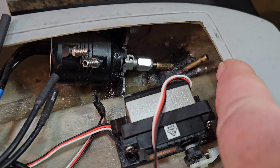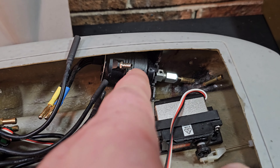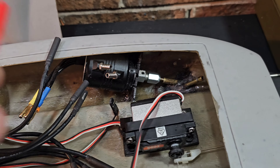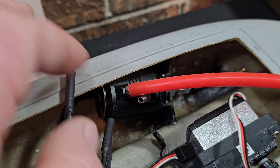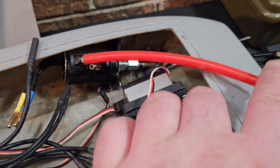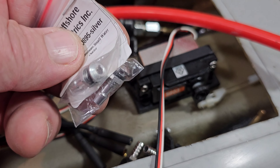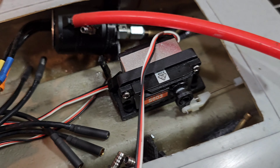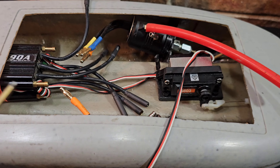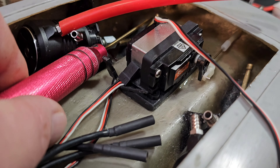Let's go ahead and figure out where we're going to put our exits. What I'm thinking is a straight shot from our through-hole water pickup to the ESC, it'll loop around the ESC, come out, go to the motor, and then out the motor. You always want your outlet on the forward exit — the highest exit on your motor water jacket. I'm thinking shoot it right through here, put my exit — these water exits — right there, boom boom, one there, one there.